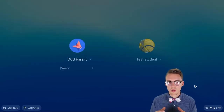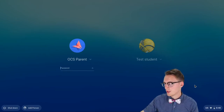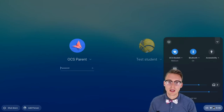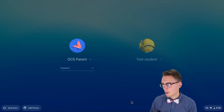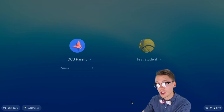So what you first need to do is sign out of all of your accounts, and you will be on a screen such as this. If somebody else has signed into your Chromebook and you can't have them sign out of it, then you should be able to force sign them out in the upper section of this window that pops up after you hit this tray in the lower right-hand corner. Once you've done that and everybody's logged out, you can press the keys Shift-Control-Alt-R.